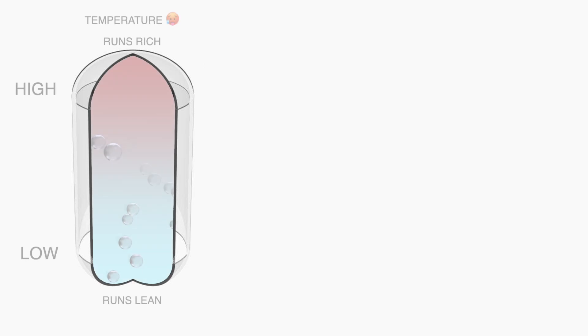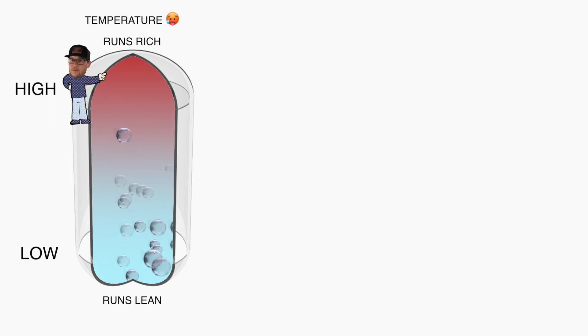Now it might make sense to you why you can't just tune the engine once and then leave it. Because that's what we would all like — we'd like to tune an engine one time and then just forget about it. Imagine a scenario where your engine is running perfectly, just dialed, master tuner level. Let's say you go to the track and it's much hotter than before. In high temperature, there's going to be less oxygen in the air. So your engine will run a bit rich. You might have to lean out your engine a bit. Because remember, you still have the same amount of fuel going in the engine, but now there's less oxygen. So all the oxygen burns, fuel left over — it's rich.